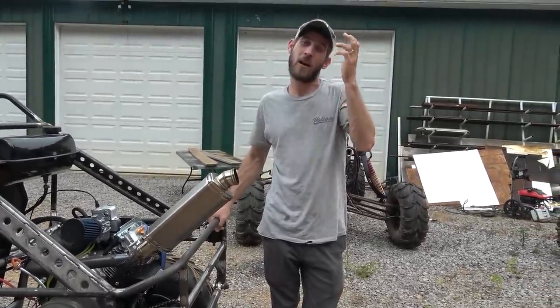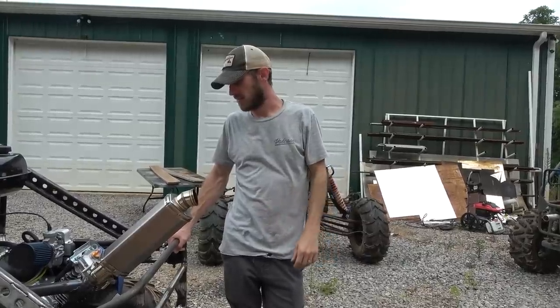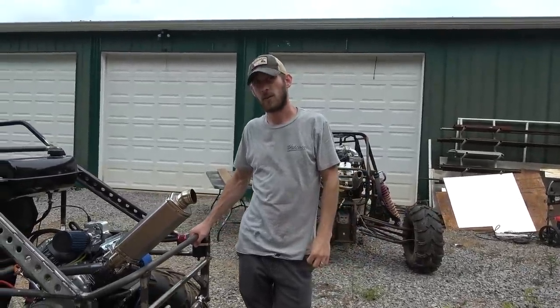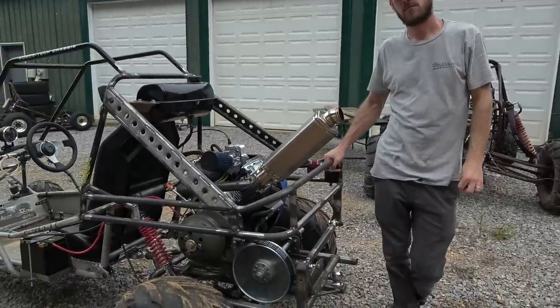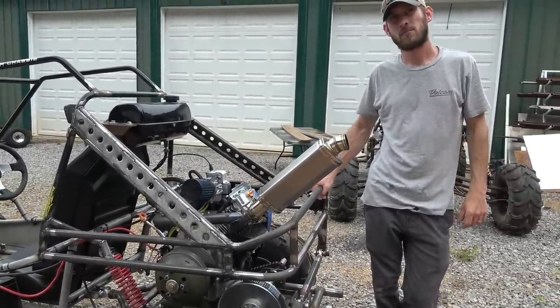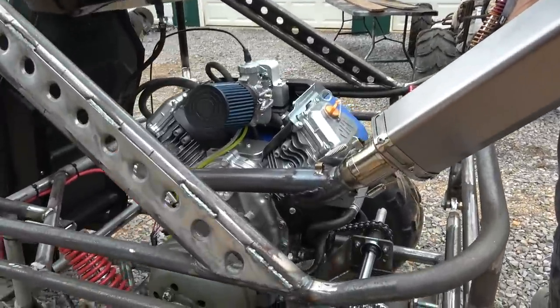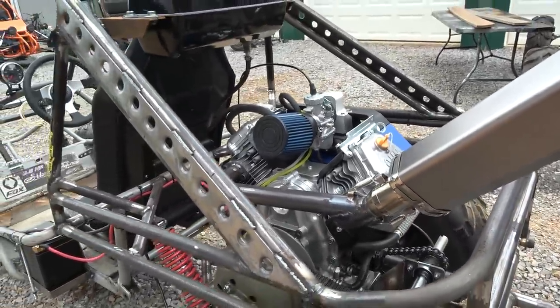Yeah, but it's just the idle circuit. We got a 27.5. I think we should jump down pretty aggressively to a 20, because that's extremely rich. If it was just a little bit rich, I would go to 25, but 22.5 or 20 is what we're going to find. Oh man, then we'll do some more pulls with this thing.